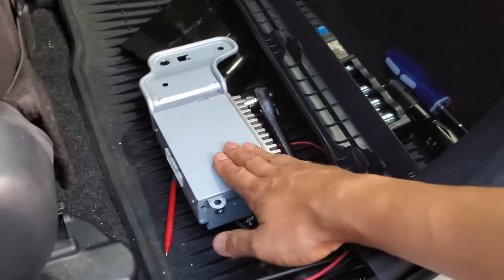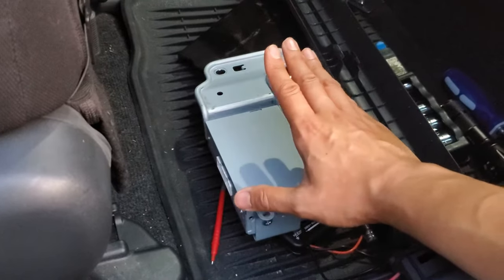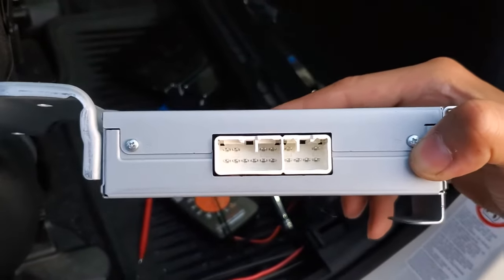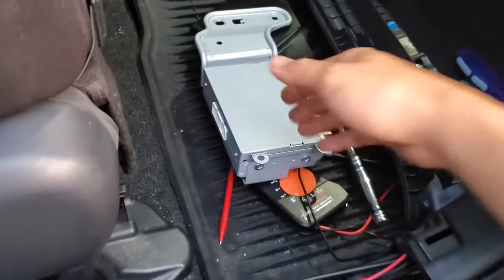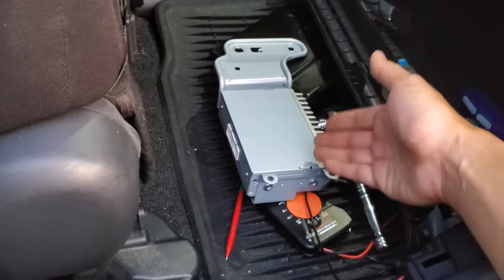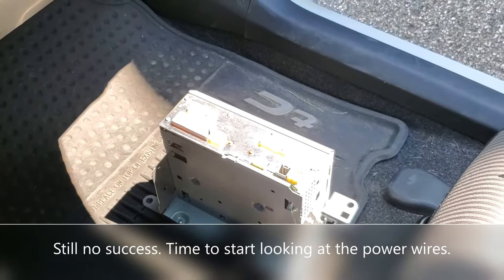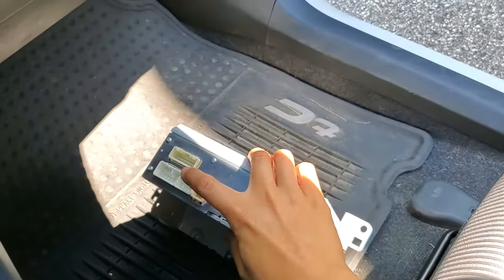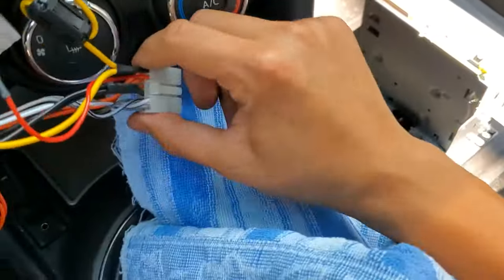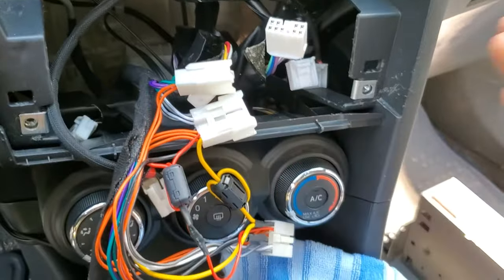Unfortunately, the test with the chassis separated but still plugged in still had alternator whine. So I disconnected it completely. I tried everything to track down this issue: took the factory amp out of the mix, connected only power and front and rear speakers to the head unit, re-grounded the head unit just at the chassis by pulling the ground pin, tried redirecting the DSP ground straight to the head unit, then straight to the factory, and tried re-grounding the DSP to the chassis. Nothing worked.